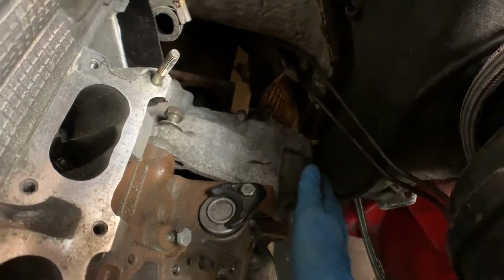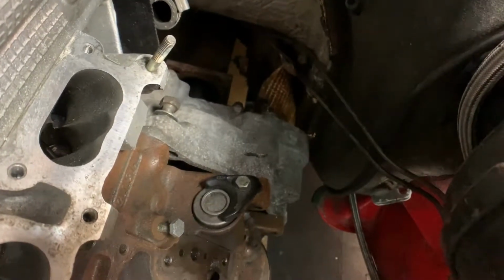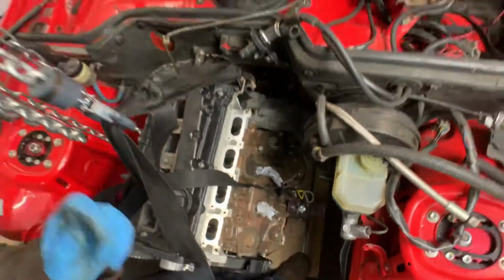So even with a bit of shaving down, it's still hitting the transmission tunnel, so that's going to need to be shaved off a bit. Unfortunately it means I'm going to need to pull the engine back again and get a hammer and start bashing the bodywork in slightly. I knew I was going to have to do this. I'm going to do this temporarily now, and then I'll need to make good a bit later on when everything's in place. So yeah, let's get the hammer.